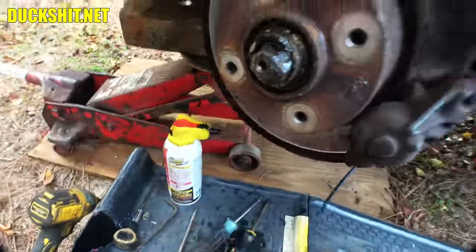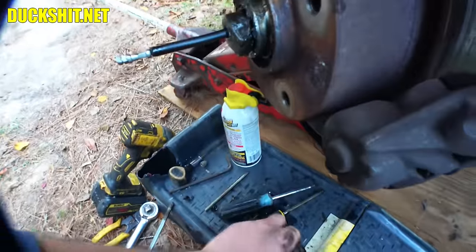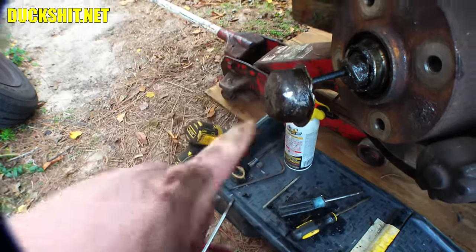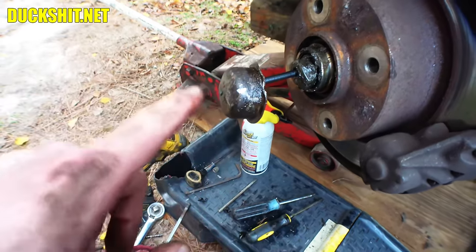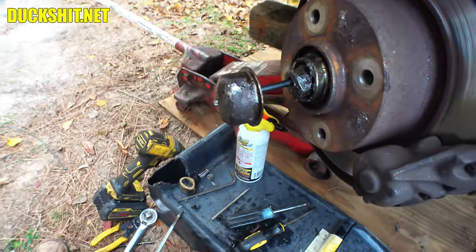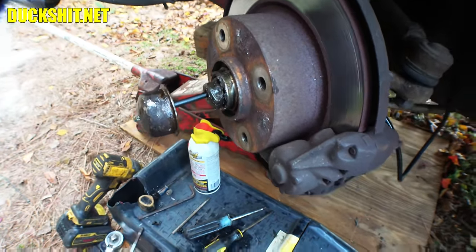We should be ready to go through at this point. I've got it lubed up and greased up on the inside. We're going to do it by feel, feeding the cable through from the back side into the rubber grommet on the back of the spindle — and there's our little cable coming out. Now I can put the bearing cap back on. The hole is not perfectly square anymore — it's a little bit wallered. I like to put the cap on the speedometer cable first, then put the cap onto the hub. If you try to feed the cable through into the hub, sometimes you just can't get the cable lined up with the hole. We get a little piece of wire put back on it the same way it was when we found it, and hopefully the speedometer is still working. If the speedometer squeals too now with the new cable, then we had more than one problem.